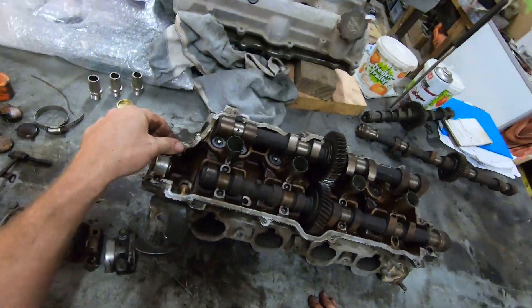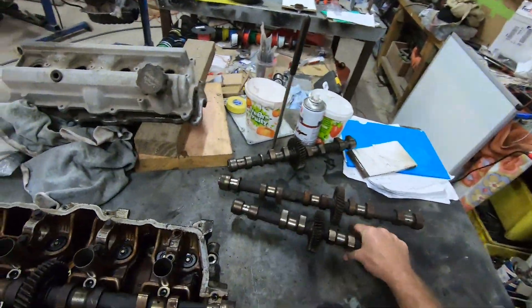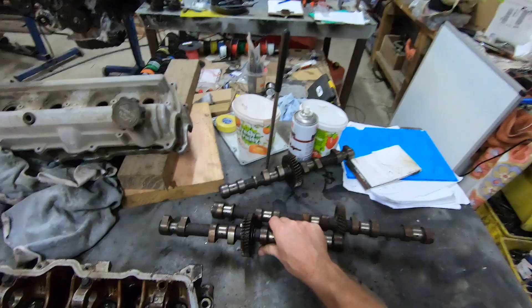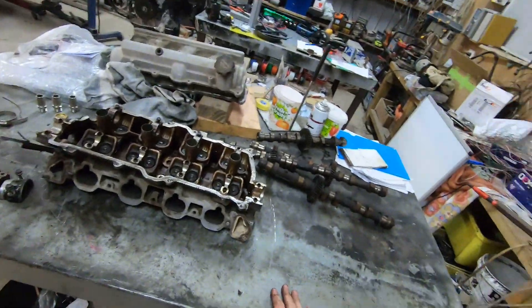So that's how you make a left-hand head into a right-hand head, or a right-hand head into a left-hand head — change the cams around. The blanking bung goes on the back; you can get those little caps and they blank off. So one cylinder head fits onto the engine twice — fits on the left-hand and the right-hand — reducing your production costs and making a simpler engine to work on. It's quite a neat feat that Toyota did that, back in 1989 when they started production of these engines.